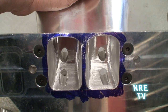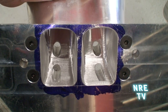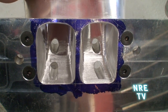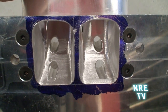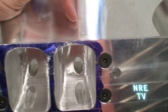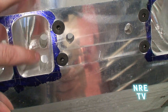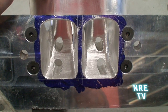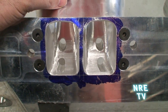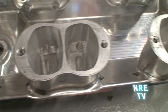If you look at the runner, you can see the injector placement. This is a dual injector setup — we've actually ported this out for one of our heavy-duty Warrior series builds. The injector itself is a straight shot at the back of the valve, which really helps fuel consumption and everything in general. Rather than shooting fuel at the floor of the port from the runner side, we inject from the other side so both injectors shoot straight at the back of the valve. That's allowed us to use less pulse width and get more horsepower. These runners are individual — each runner bolts onto the base itself.